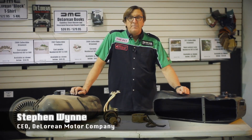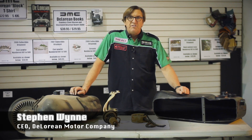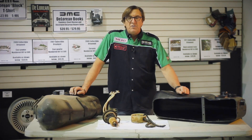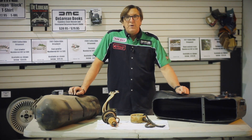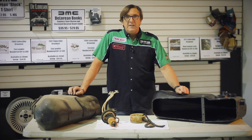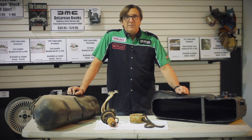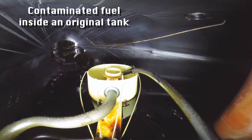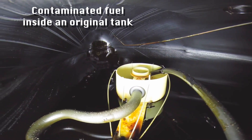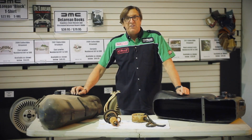In this segment we're going to talk about fuel system contamination. One of our more common tech questions is: you have a DeLorean that's been sitting for a period of time, you come to start it, go through a diagnostic, and find there is no fuel coming to the engine. We look in the gas tank and find the fuel is contaminated and turned into a gooey gel, causing the fuel pump to seize up and massive contamination in the fuel system.